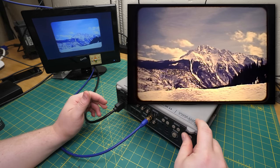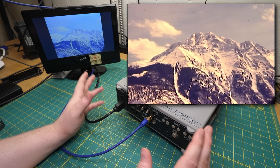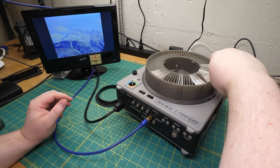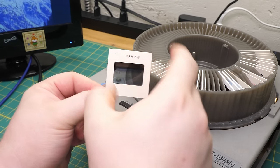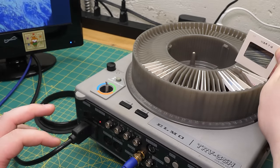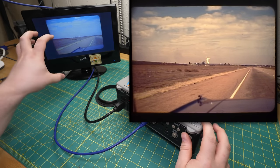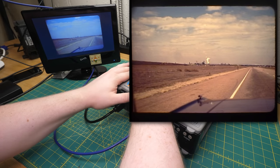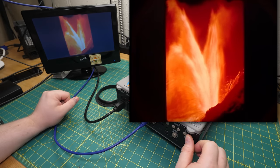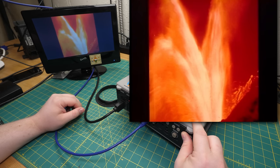For instance, if we're just looking at a slide and wanted to push in on the center of it, we can do that fairly smoothly. I suspect much of why this feature is here has to do with portrait shots. Something I never really realized about slides: even though the film frame is rectangular, the slide is perfectly square — that's for dealing with portrait photos, you can just rotate them right-side up. Because the NTSC video frame is rectangular, if you're looking at landscape shots you'll want to zoom in to fill the screen, but when you come across a portrait mode image it's going to crop off the top and bottom, so you need to be able to zoom out to get the whole thing.